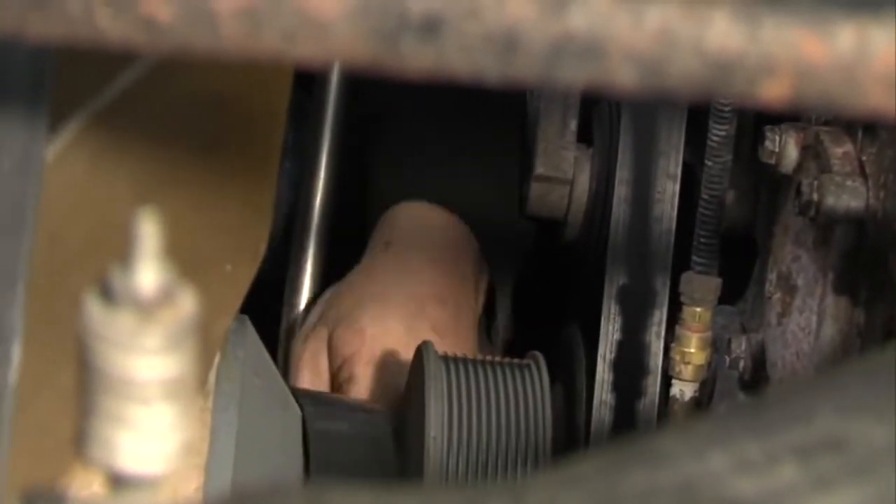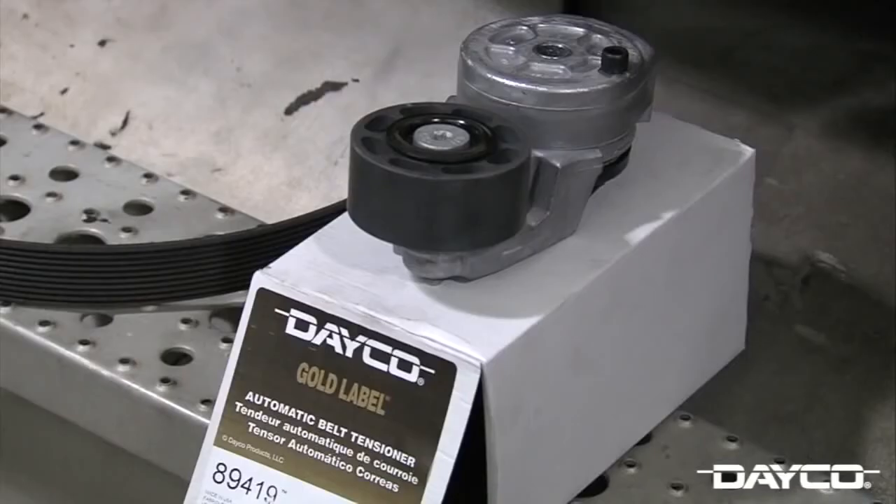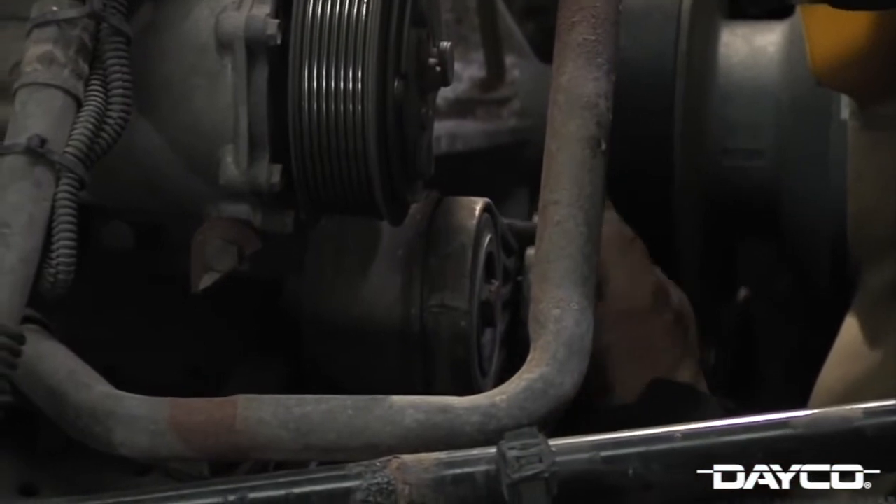To have a closer look at the Detroit Diesel engine's tensioner and serpentine belts, first relieve tension on the belt to remove the serpentine belt off the pulleys using a half-inch ratchet. We did use a long handle ratchet, but a short handle tool should work too. We are also replacing the alternator and air conditioning tensioner. Relieve tension on that belt as well to remove the serpentine belt off of the pulleys using a half-inch ratchet. You can now remove the engine's belts once tension has been released from both tensioners.